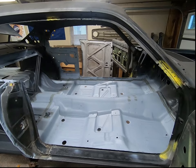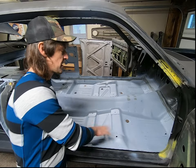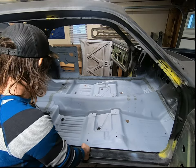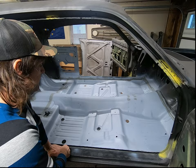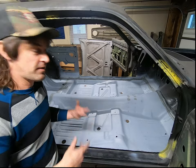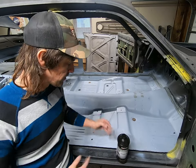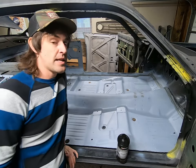But there's a couple things you do to kind of cut down on the dust, and we'll go over that. So first thing I did with a lot of this, I went through with sandpaper and just kind of knocked off some areas, kind of got a little bit of the gloss off of it because this was sprayed a few weeks ago. So I just want to freshen it up for whatever we're going to stick on top of it. And then go through and blow a lot of it out, and then vacuum it out. And then there's going to be a little bit of residue in certain places, heavier dust, that might not pull up in the vacuum and you may have missed anyways. So we'll go through and I'll use grease and wax remover. It kind of cuts down on any contaminants on there, any grease, any wax, obviously, and fingerprints, stuff like that, that might cause paint adhesion issues.